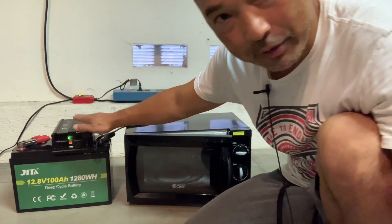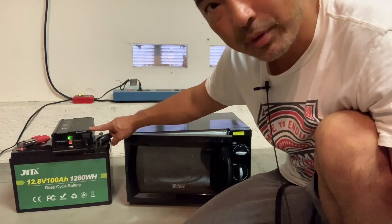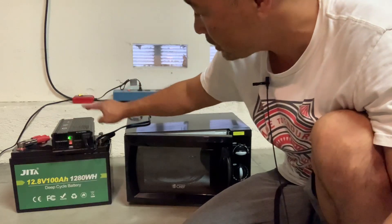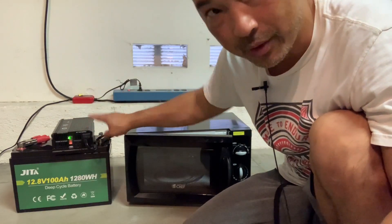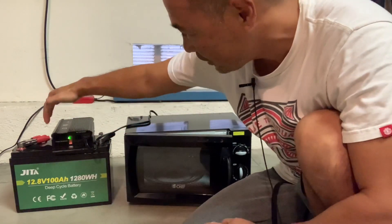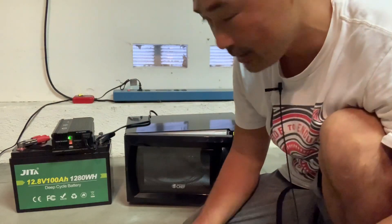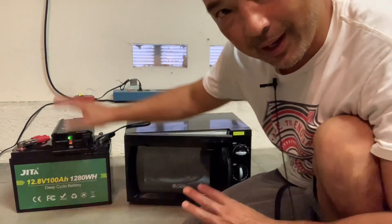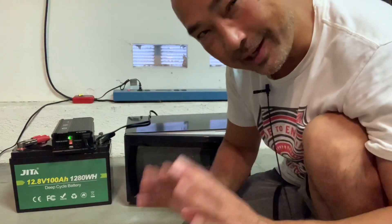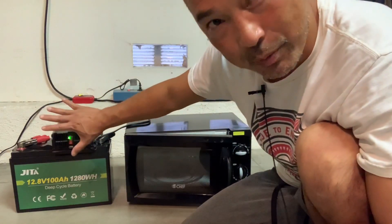Before I come back, let me tell you one thing: don't put your inverter on top of your battery like I did here. The reason is the chassis is grounded. You don't want to touch that positive prong to the chassis of the inverter — you're going to get sparks. I felt nervous about doing it like this. I moved it over to the ground side so if I did touch it, it wouldn't be bad. Please don't do it yourself — keep it away from those prongs.